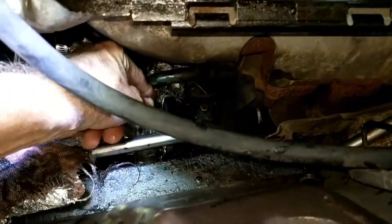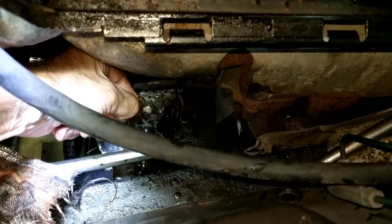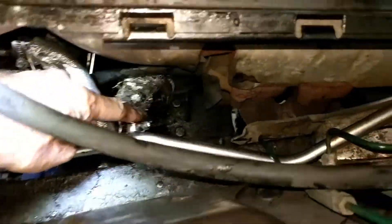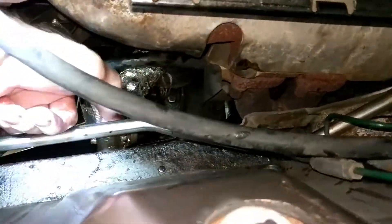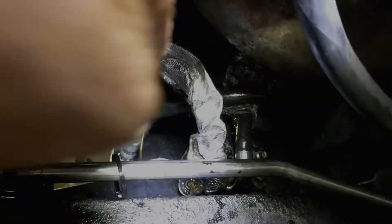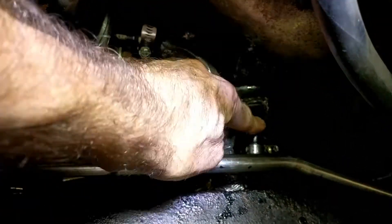I cleaned up down the bottom and I've taken the heat shield — look, this is the old one, and I put a new one on when I was in here about six months ago. And it is saturated. So I think it's pointing to a leak right here, and it's flowing down the pipe. This may not be the only leak, but it's coming down here and saturating this pipe, which looks like a low-pressure return going through the cooler. This one seems to be clean.